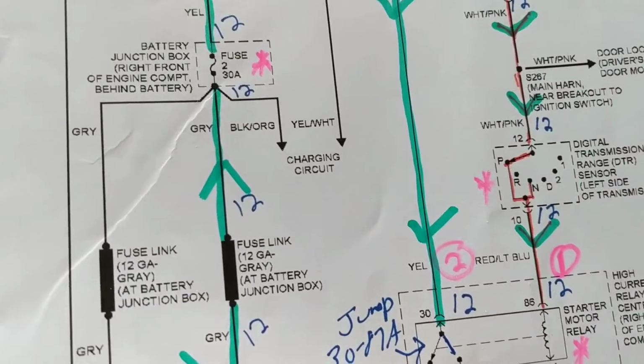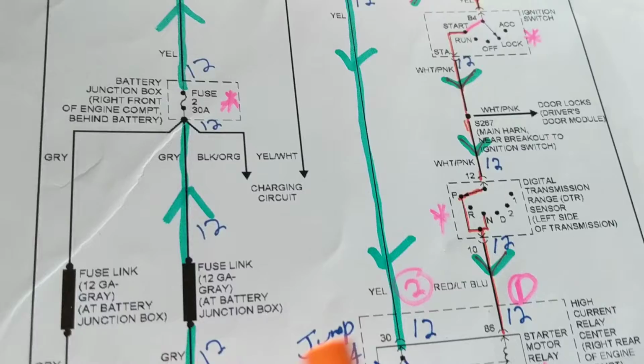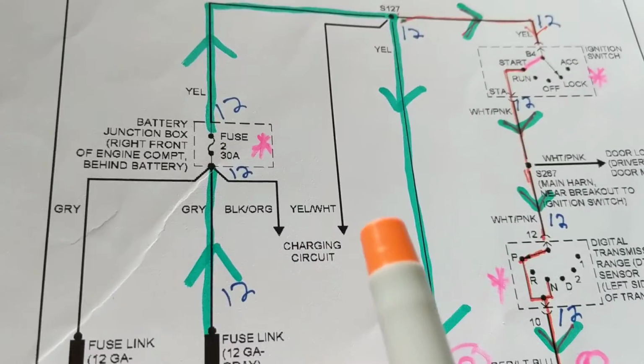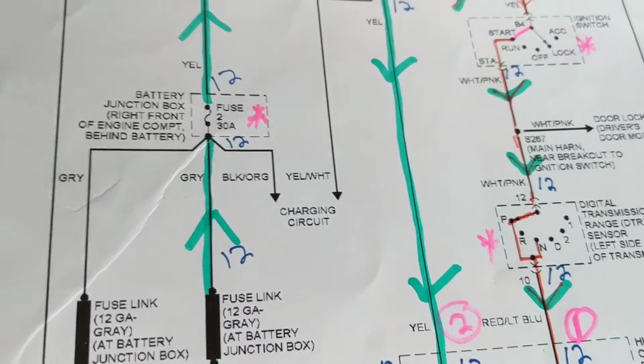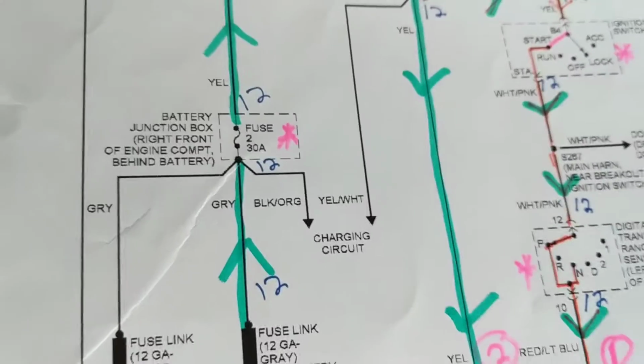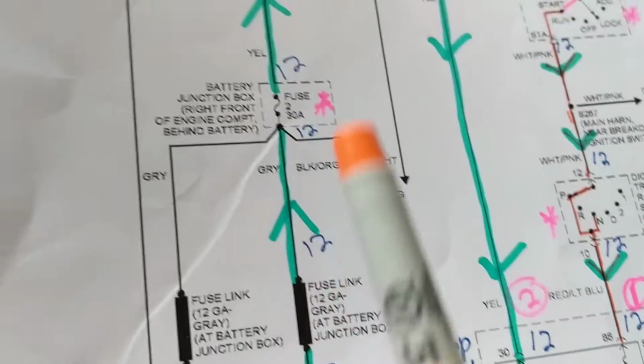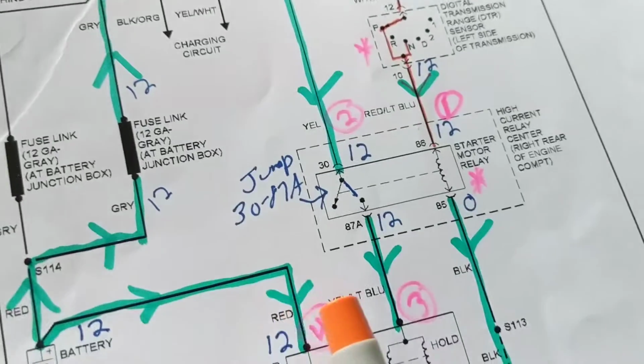So right away, before saying that maybe it's this and it's that, the first thing that people do, if they do think it's the alternator, is go in and change the alternator. Not a good idea. It could be the fuse links that have opened up. It could be a fuse that has opened up. Now, how to approach it?